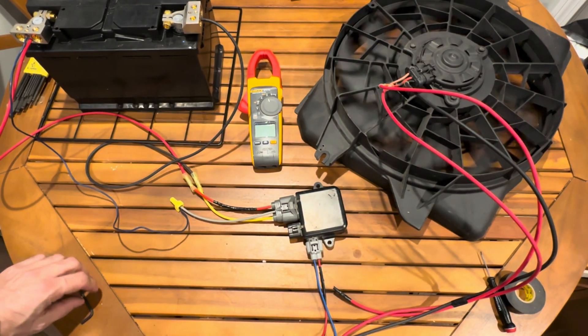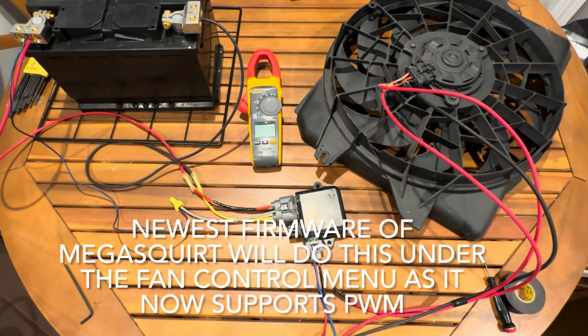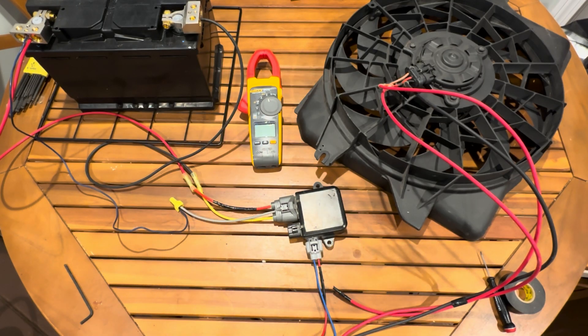You can get creative by using a two-position relay — one position being your PWM control from the ECU, and by toggling to another contact you can either ground or open the wire. If you open the wire the fan defaults to full speed; grounding it shuts the fan off. One use case: using a VSS signal, if you go over 40 mph and want to turn the fan off, you may be able to program that into your ECU output or use a spare output to accomplish that.